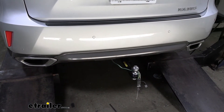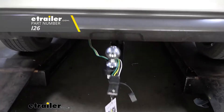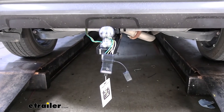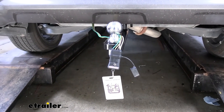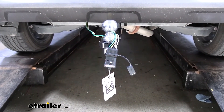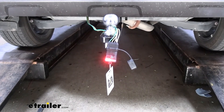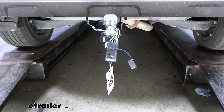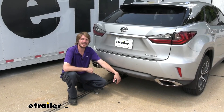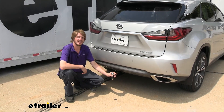We've now gone ahead and plugged in a tester because at this point our installation is complete, but we want to make sure everything's working properly. You could plug into your trailer, however I highly recommend getting a tester like you see here — you can get this here at eTrailer — and this way you can ensure your vehicle's working properly, because if you have any faults on your trailer it could give you a false reading. So now we've got it plugged in, we want to make sure that we've got our left turn signal, right turn signal, tail lamps, and brake lamps. And we can see all of our signals are working properly back there, so at this point we're ready to load up our favorite accessories, hook up to our trailer, whatever we want to do and hit the road. And that completes our installation of Stealth Hitch's full rack receiver and tow package on our 2018 Lexus RX 350.